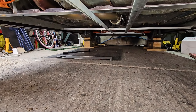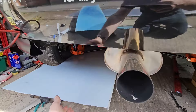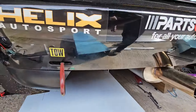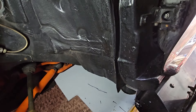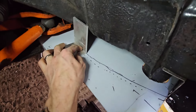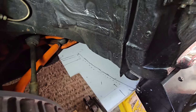I'm going to get a full size piece of floor pan in here and see if it works. A few moments later — here we have part one: super flat floor. I've currently left it long, so it actually comes right out the back. One flat floor section — that is in. Let me bring you to the front. If you look under here, it's actually cut in really nicely around our jacking point. And what I'm about to do is come in here and mark up where I'm going to trim it. Then we'll fold a lip on that and close things off there as well. I've taken this angle and marked the line of the inside of the arch — I want an upstand there to stop air going in under the floor. So I'm going to take that off, cut a line there and try and fold some sort of upstand.